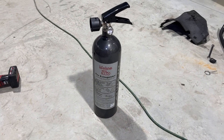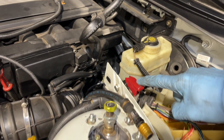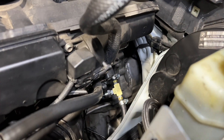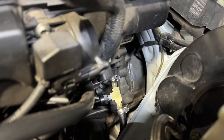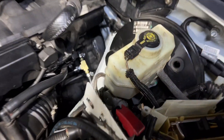Next I'm going to splice into the fuel line to get the T for the fuel pressure sensor. Before getting into fuel, have yourself a fire extinguisher handy - safety first. Fuel pressure sensor is in place, got the line spliced, hose clamps tight. Now I want to test to make sure I've got no fuel leak - I've got a little switch for my pump out to power the fuel pump. I turned on the system and checked - no leaks, looking good.